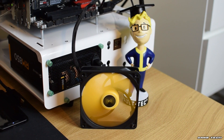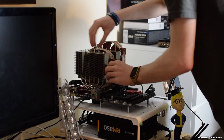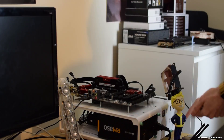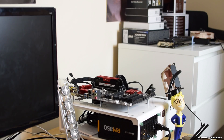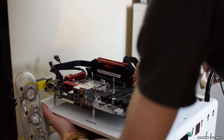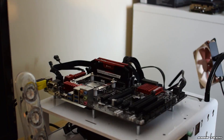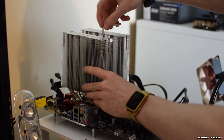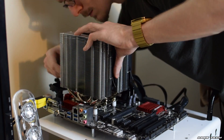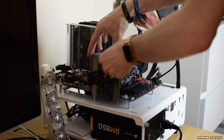With the low speed adapters attached, the fans are brought down to 1100 and 1200rpm respectively. The installation overall was pleasant — mainly due to the solid metal back plate and large metal pieces that hold the cooler in place. You remove your existing cooler and components from the PCIe slots, put 4 back plate bolts and rubber washers through the metal back plate and slide it under your board. Place 4 white plastic spacers on top of the bolts, fix the mounting bracket on top, and screw in the 4 nuts. Apply thermal paste, place the cooler onto the CPU, then secure it with the metal mounting bar and 2 screws. Fix both fans and plug them into the CPU fan headers on your motherboard. Note that this cooler doesn't include a Y-connector, but most boards have more than one fan header near the CPU socket.